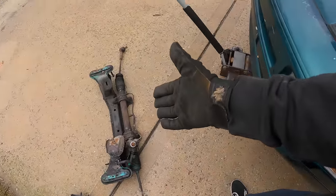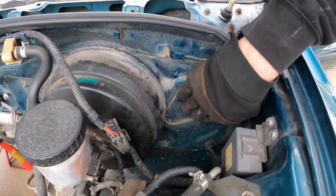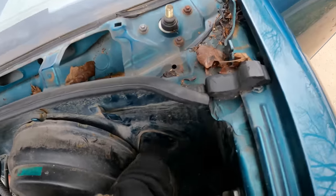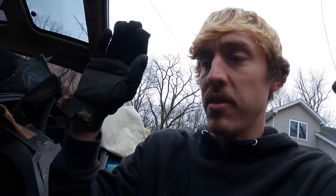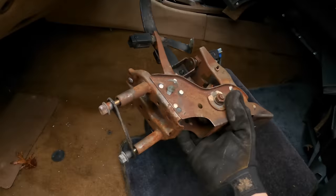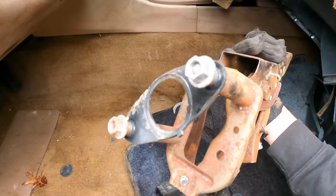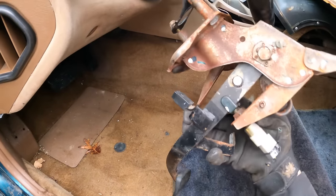Since we're not going to use this subframe, the next thing I want to do is start the manual swap process. There's a little plate in here — this is where the clutch master cylinder is supposed to go, inside and outside — but it looks like they have it sealed up pretty good. If you look at it from the inside, it's completely covered with sound deadening. I'm going to try and get the rest of that off so I can fit everything in there. There are two bolts that go through the firewall, and the most important bolt is the top one — without it you're just flexing the firewall and it will eventually rip.